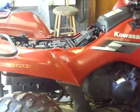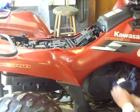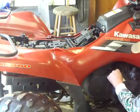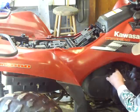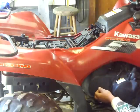It was blinking slowly before, and now it's blinking really fast. So we're on the right track. We know that this is the problem with it. So you turn it back off, and you go down here, and right where there's a switch, there's a safety switch on the belt in case the belt breaks or gets so loose that it'll come up and hit the switch, and it'll knock it into the limp mode also.